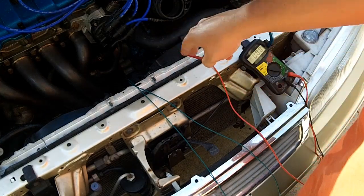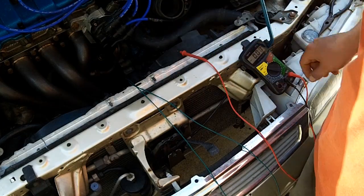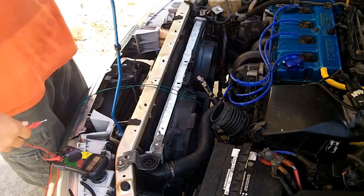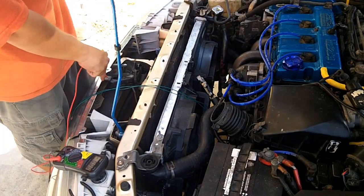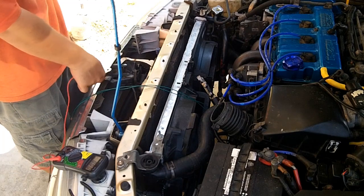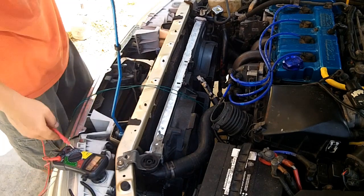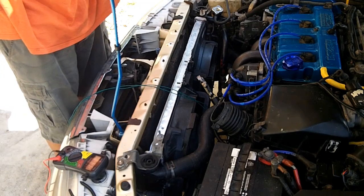So now I want to swap that pin onto the reverse and then put the car in reverse and see if I get battery voltage on that pin. Well, I accidentally forgot to record, but whatever. Started, put it in park, switch it to reverse, got a signal, got a negative battery voltage signal. Negative. I don't know how that happens. But that's reverse. Negative battery. Maybe it's because I'm shorting at the ground.